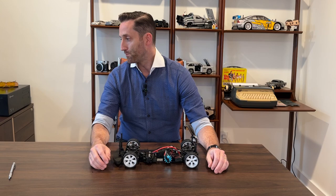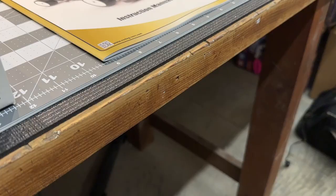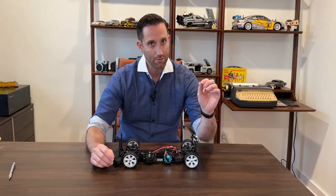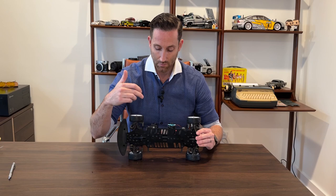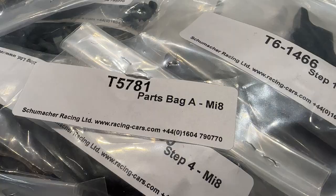The track I usually run this at also has a hobby shop, so I bought this there. I try to buy locally where I can - I understand it's not always possible, but even if it costs a couple dollars more, it's nice to. In the manual, it shows a few different places where it explicitly says to use thread lock, and some places where it explicitly says don't use thread lock. However, because a lot of these are steel screws going into alloy parts, I just use thread lock everywhere. I got burned on my CRC carpet knife having screws come out where I should have just used thread lock - even if the manual doesn't say explicitly.